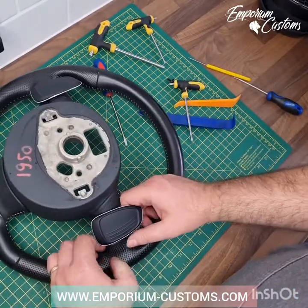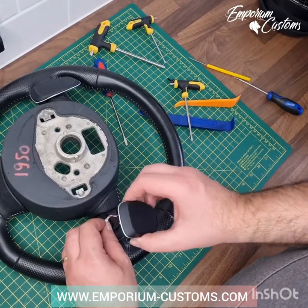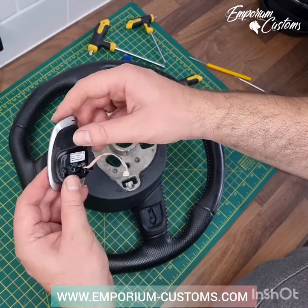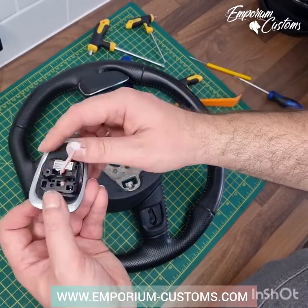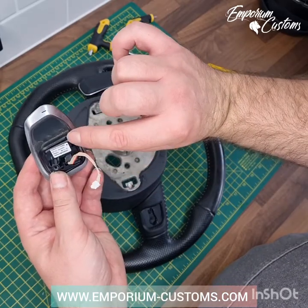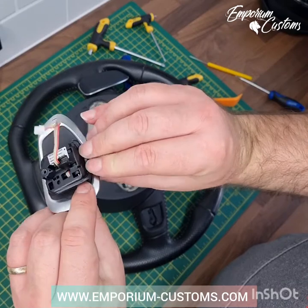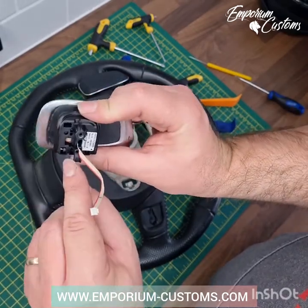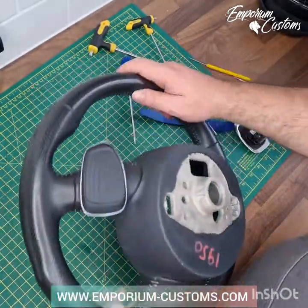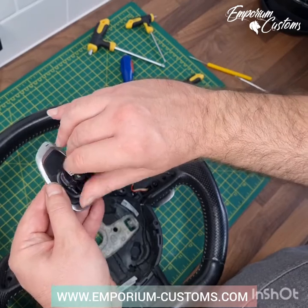Just be careful of the mechanism — then carefully extract the cable out. Make sure the little clip on it doesn't get stuck. Don't force it; if it's not coming, check why it's not coming. That's what your paddle shifter looks like — that's your shifter module. If you're changing for some of our paddle shifters or something similar, you can remove these. There's a little rod that runs along there — normally there's a hole top and bottom where you can push it out. The B9s certainly have that. This one only has the one hole at the top, so you'll have to get in there and push the rod up from the bottom to enable you to remove that.